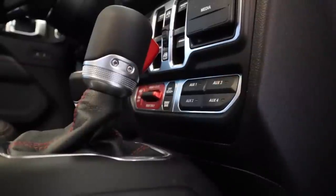The new Jeep Wrangler JL and Jeep Gladiator JT come with an awesome factory add-on of four auxiliary switches already inside the cab and ready to go. These switches can be configured as momentary or latching type, and at the touch of a button you can program them to be powered by the battery or by the ignition switch. It's a great way to wire up additional accessories.